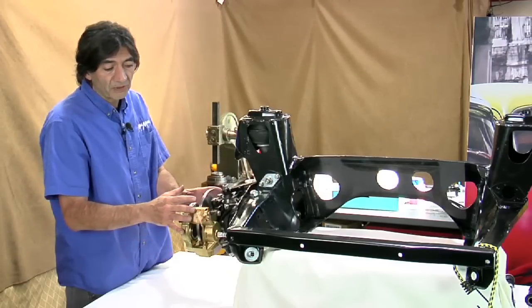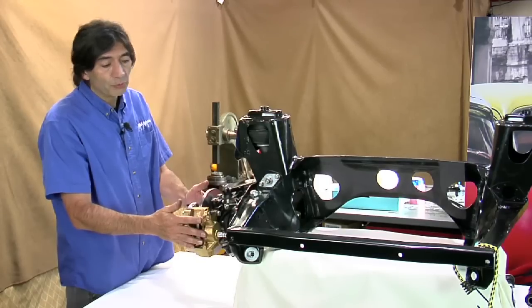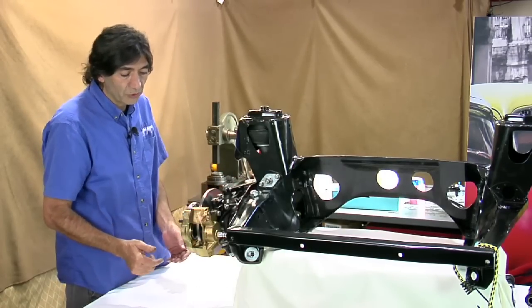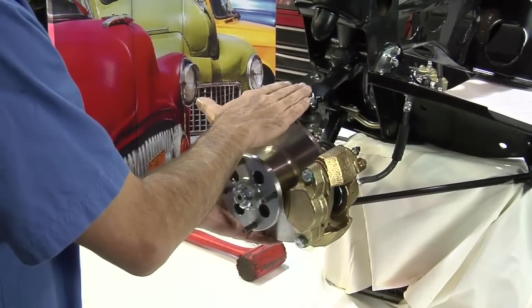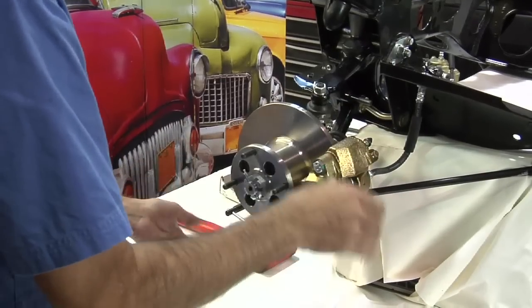It's of course very popular with the Minis to keep the 10 inch wheels. You can build one of these sub frames and install the early Cooper S disc brakes on the same spindle if that's what you want to do to run the small wheels. We even have a kit that lets you take these big brakes off, put the smaller calipers and smaller rotors — fairly minimal number of parts to change — and you can run the small wheels.